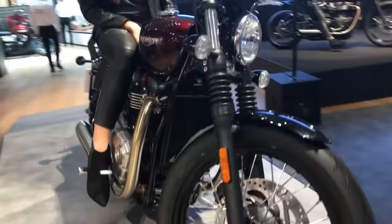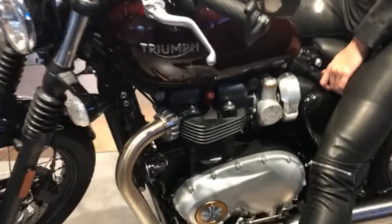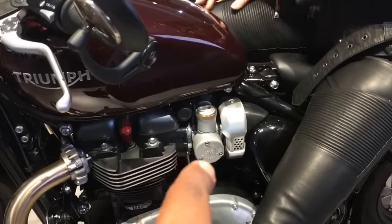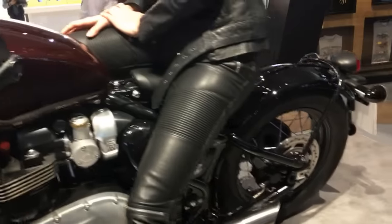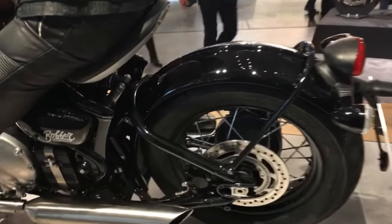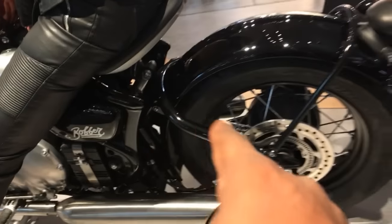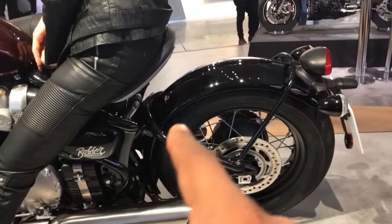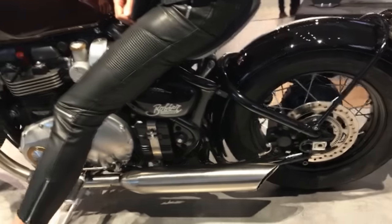Now I'm going to the other side of the motorcycle. You can see the throttle body here — that's one half of the airbox — and that's why it's going to be hard to retrofit onto the T120, because this split airbox is going to be hard to manage. I was talking about the rear suspension: it's mounted in a new place, and the swing arm — what they call the swinging cage — is a new idea. It looks like an old hardtail but with a hidden suspension unit.